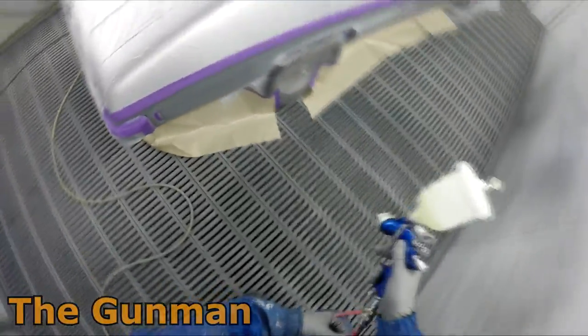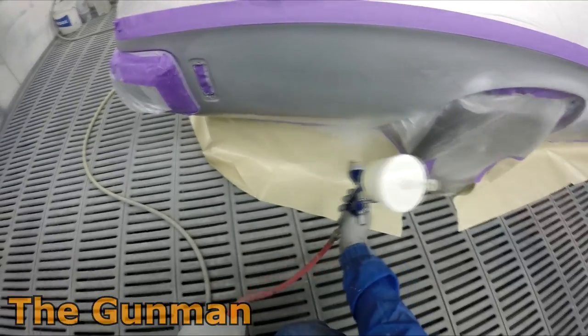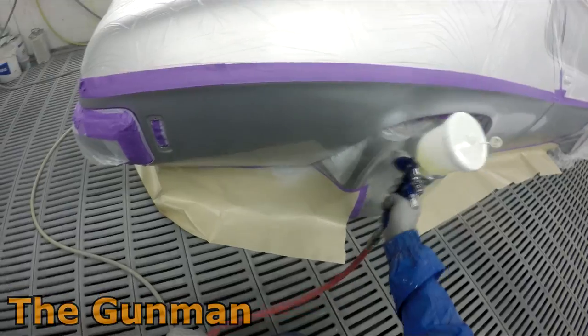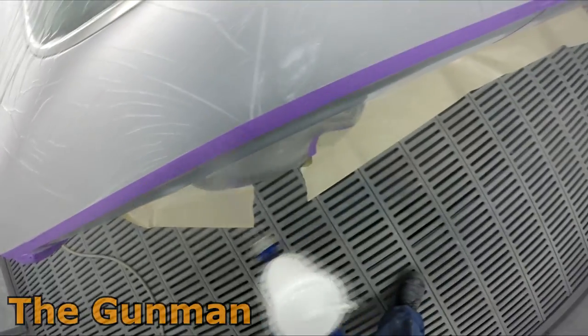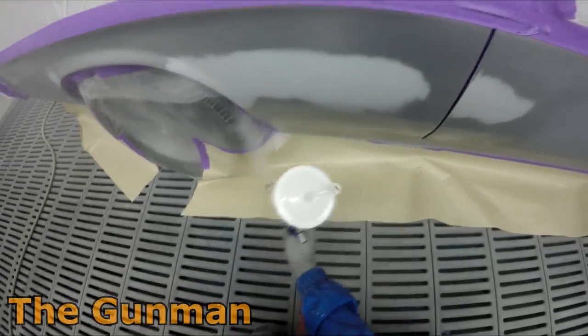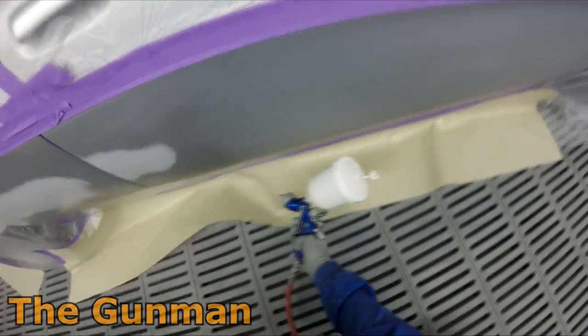on. So what I'm using first up here is some 222S. It's a great product. It's actually mainly used as an adhesion promoter. It's something that I used a lot of years ago. Now I'm using solvent. We've got a bit of a risk of shrink back and fry ups and stuff like that. This actually acts as a good barrier to sort of seal down some of that old paint that we've cut through underneath there, especially on the back edge of that quarter panel.